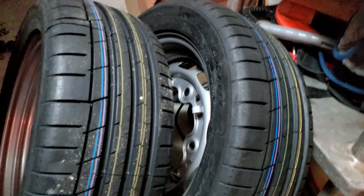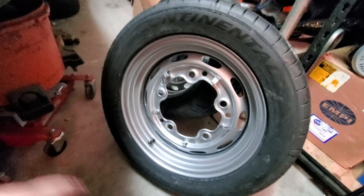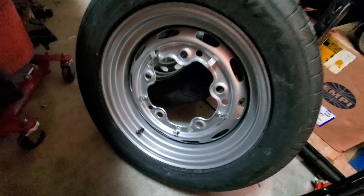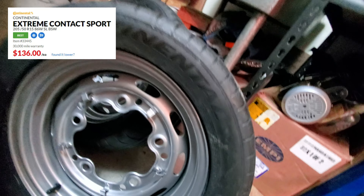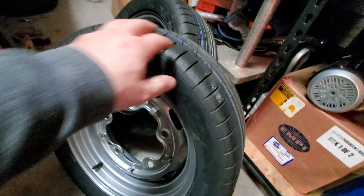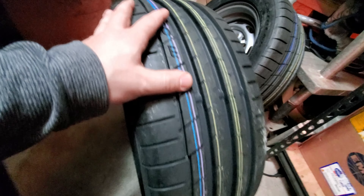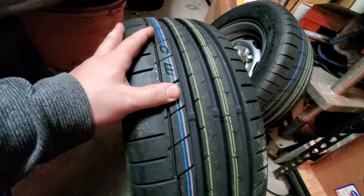Welcome back. What I got here are the new tires and wheels for Goose. I kind of like the way that these look, and they have some venting here — a little bit of venting to help out with the brakes staying cool. They're 15-inch wheels and I went ahead with these Pro Contax — ZR rated 205-50R15 — pretty awesome. They're definitely going to give us some more traction on the road, and that's what we're looking for when it comes to all that horsepower.